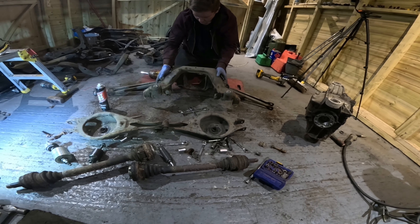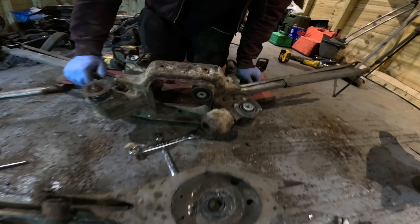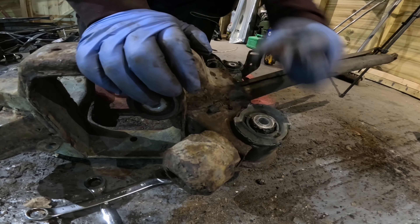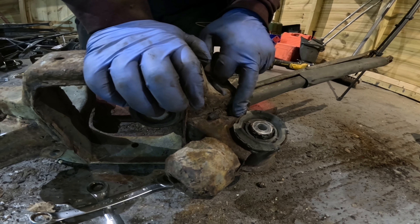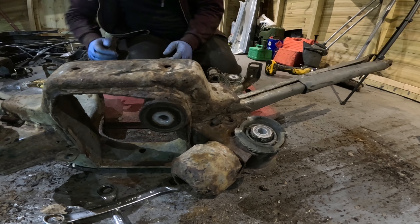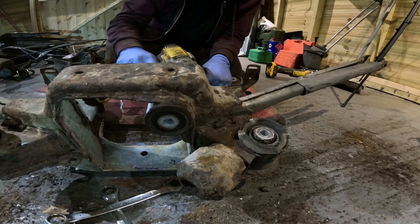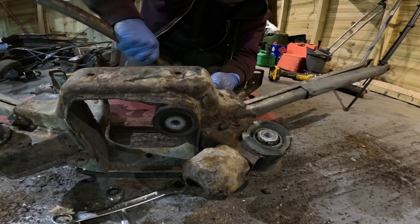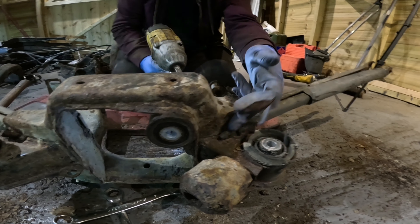Something else to consider - this one's got a bit of corrosion in the spring perch area. It's really common for these to rot through. That one's well on its way - we'll have a good look before getting it powder coated. A couple more years on the road and it would rot through and your spring would fall through. So before you do one of these overhauls, check for rot - you might need replacement arms. They're still pretty cheap, about 30-40 quid for a pair second hand.